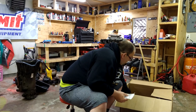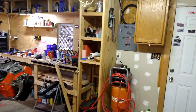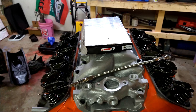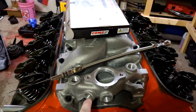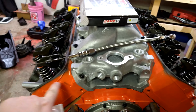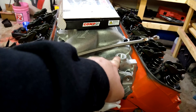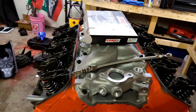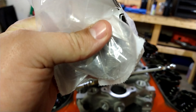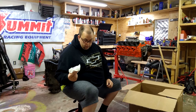Let me show you the top of my intake manifold. You can see all these open ports on the top of the intake manifold. This one is from the water pump, this one goes to the heater core — I'm going to plug that one up. I think this is where I'm going to put my water temperature sensor. I bought a bunch of plugs for those open ports — they're little threaded plugs that you can use an allen wrench on.